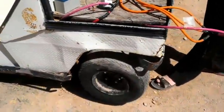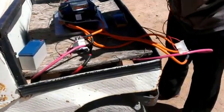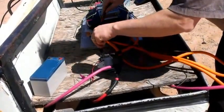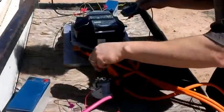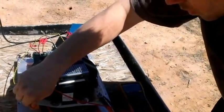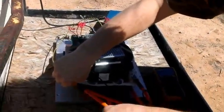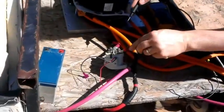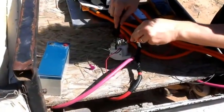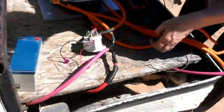Paul's just going to go and check the batteries and make sure that we don't have one that's really unhappy. So what do we got there? 24.3 — that'll work. Minus 24, so you just have the probes out, right? The contactor connections do not look tight. So we'll get a hold of a wrench and fix that, and then we're going to do a test.